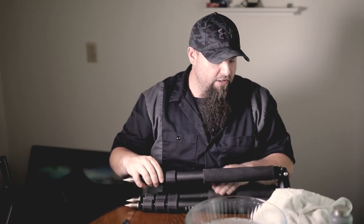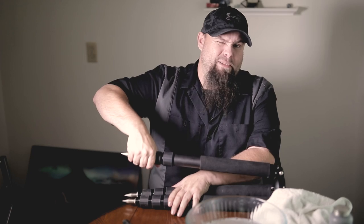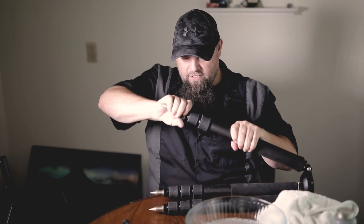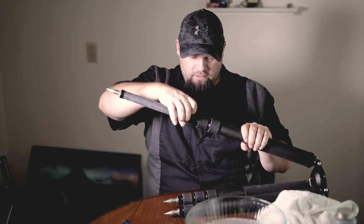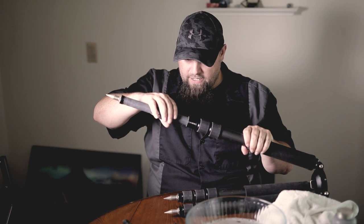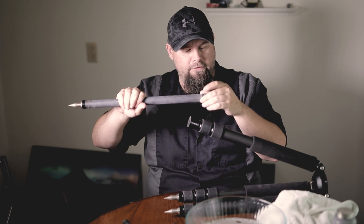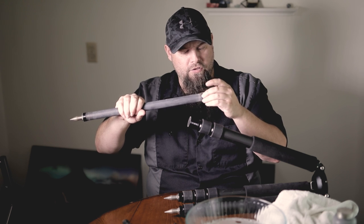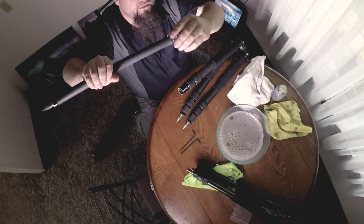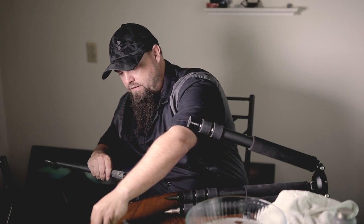Let's dive into one that I've never cleaned or taken apart before — the Feisol 3472. This is the one I've made a couple of videos on. I loved it when I first got it, but then the legs started to bind up to where I can't operate it properly. We're going to unthread it starting here, all the way off the threads. It looks like we have a very similar clip that goes on the threads. We take this off, and then here we have a series of rings — short, wide, short, wide — and another sleeve. These are really, really gunked up; there's so much salt from shooting around the ocean that it's pretty nasty.